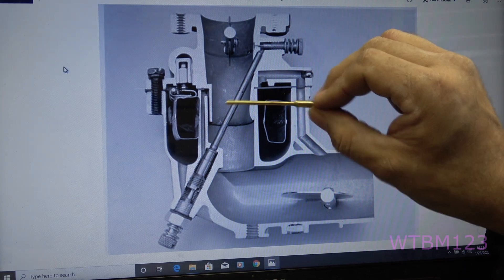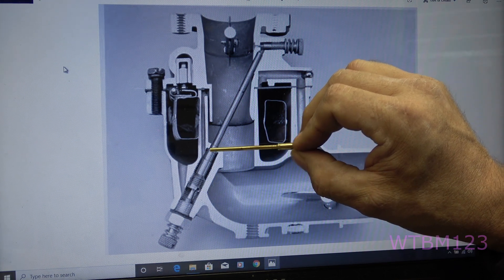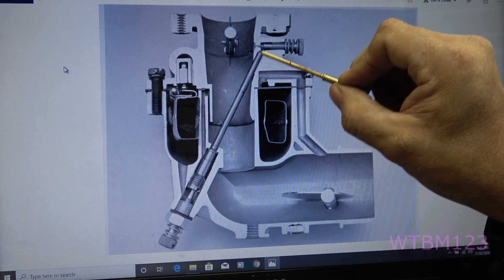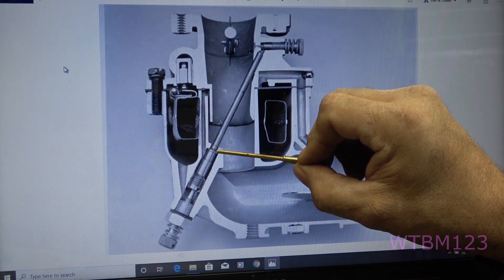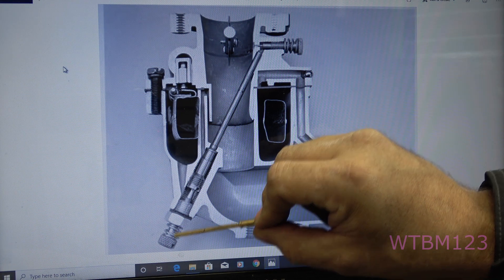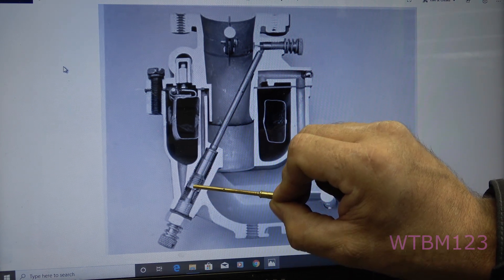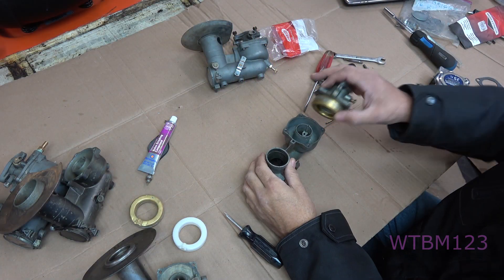The holes up in the side of the tube are above the fuel level, but this hole here will let the fuel leak out — it'll come past this tapered seat and run right in. That's why you have to make sure when you put this emulsion tube in, it goes up in the top part as you're screwing it up, and you get it seated right. This is the part we took out and there's an o-ring in here. When you put this in, you don't want to gouge the needle because it's soft metal.